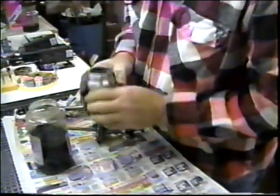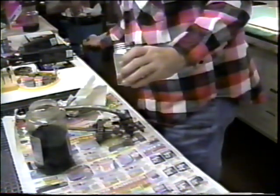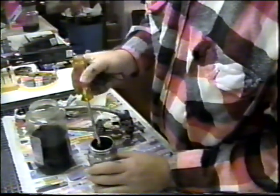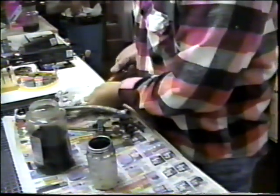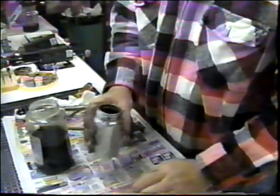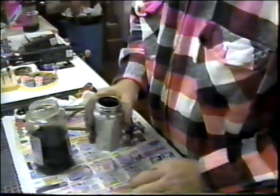I'm glad I got that stuff all staged up. We've been blessed with a low humidity day, but the wind is howling out here. One great idea I've come up with many times - when you're going to start a new plane, always run some thinner through the gun first. Everybody's always crying the blues about how expensive thinner is. Well, this is a good place to use up your old thinner - the stuff that's a hundred years old, all these old off-brands you've been saving. Boy, look at the junk that comes out of here - I've let this sit and it's not softening up. There's some real crap in there. Always start with a clean gun.